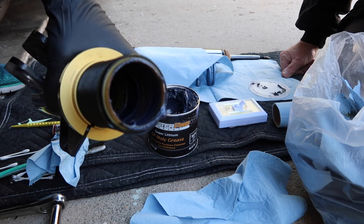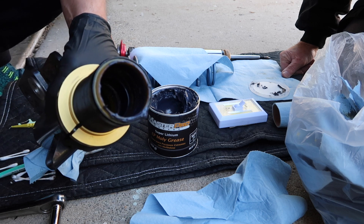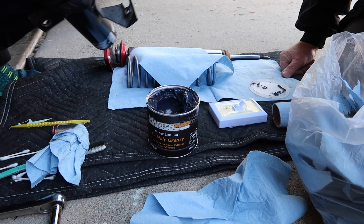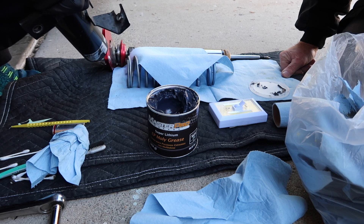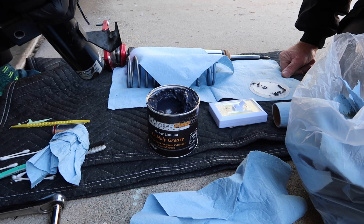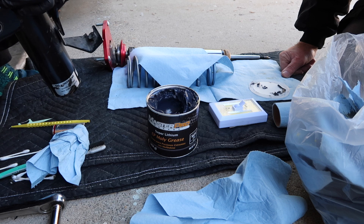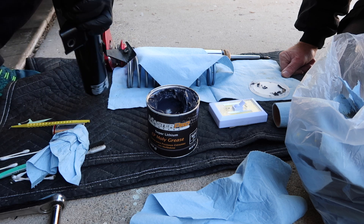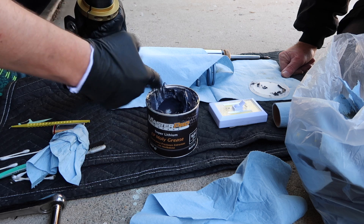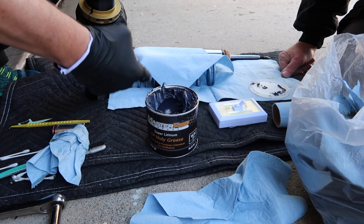As you can see I've packed the grease in here — this is just cheap moly grease from O'Reilly's or AutoZone, it doesn't have to be anything fancy. You could use a higher temp grease like wheel bearing grease from Redline, but I didn't have that available locally so I just went to the store yesterday. That's basically what you want — a nice good pack of grease in there. I need to get a little more in the bottom ring because unfortunately it gets pushed out over time since the bushings aren't a tight enough fit.